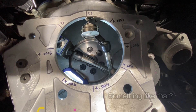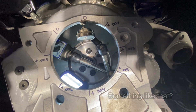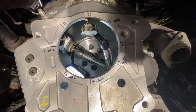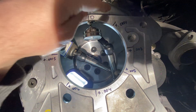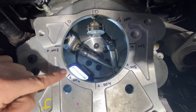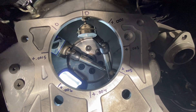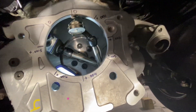The furthest difference between any two numbers is still well within spec. To be clear, the spec that would be a problem is twenty-five thousandths — the dial indicator can get a little confusing. As long as it's within five thousandths runout, which is ten thousandths total indicated reading, and nothing is widely out of range, we're good.